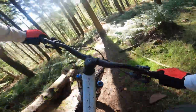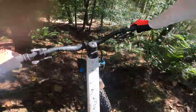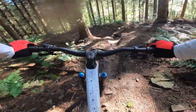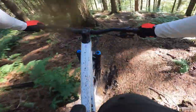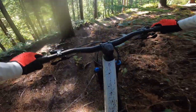One criticism I had of last year's bike is that the triple-phase suspension kinematic works so well to make the bike super playful, but in chunky sections it can feel a little bit unbalanced — the fork is hugging the ground really nicely whereas the rear end is being a little bit chaotic. In practice, the coil shock makes for a much more composed bike, smoothing out general trail chatter and making light work of square-edge hits. I reckon that's made the bike feel much more balanced, and I've been able to go through really chunky sections with a lot more speed and a lot more confidence.